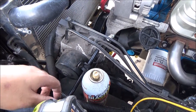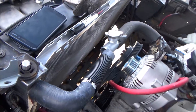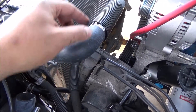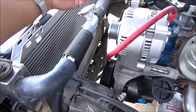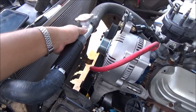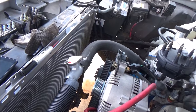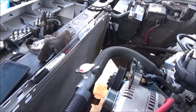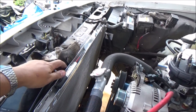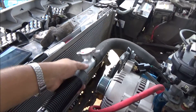For the radiator hoses, I still need to figure out the lower one. For the top hose I have to use a portion of a Lincoln Mark VII hose. For the overflow, I'm using a tank from a 2004 Ford Focus I had laying around — I'll buy a new one just in case, but it seems like a perfect fit. I just need to add a support, probably using one of these holes with a bolt and a clamp so it's not moving around.